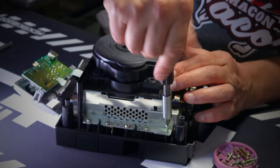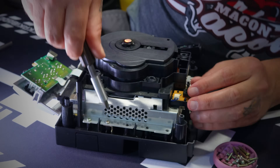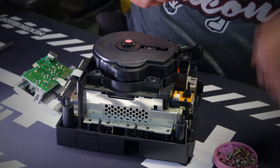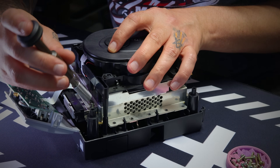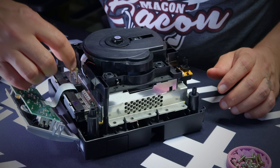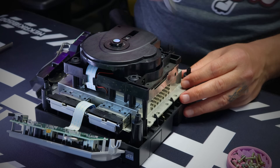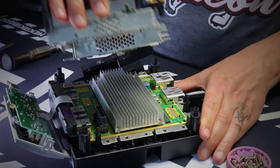On the Flippy Drive mounting side, we've got five more screws to take out — go ahead and lefty-loosey each one right out of the side of the GameCube. Grab yourself a Phillips zero bit. We are going to pull the two screws off either side of these little assemblies — four screws total. The whole little assembly just comes off with the screws in them; lift them off and set them aside. Grab that last screw out of the back you forgot, and it's time to lift off the drive assembly — just pull it right up vertical and it comes right off.